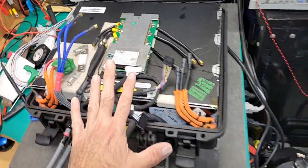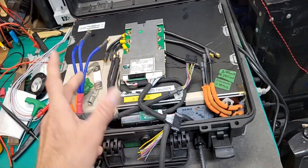Let me explain the power math: the motorcycle's average power will be maybe four kilowatts. If I split that evenly across my actual Zero battery and these two batteries — 50/50 share of current — I'll have half the current, so about two kilowatts per battery set. These batteries are 15 kilowatt-hours total (two 7.5 kWh units), adding to my actual 12 to 13 kilowatt-hours usable on the Zero. It's important to have the impedance matched so I drain the same current per kilowatt-hour.